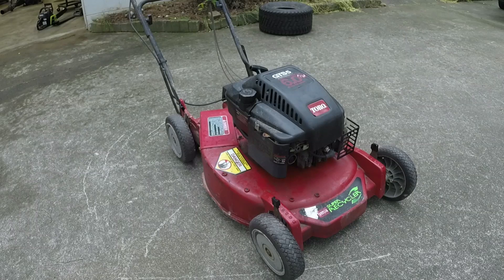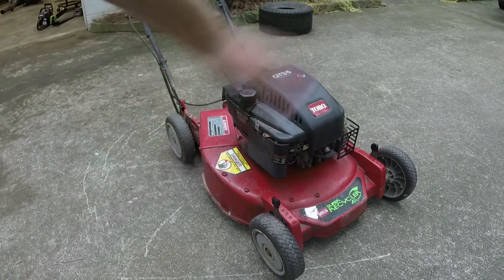There was debris in the carburetor the first time. I cleaned it and put it back together, but it was still surging. So I drilled out the jet on it, and that seemed to have fixed everything. That's good. I'll show you that it runs and throttles down and stuff too.